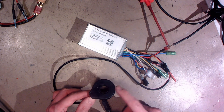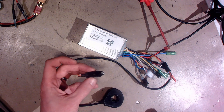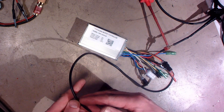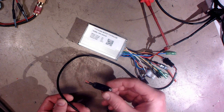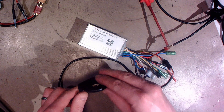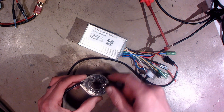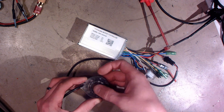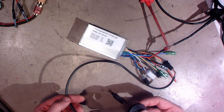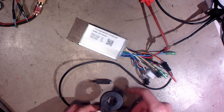But I don't want to install this to the bike because the bike already has this kind of hall sensor. I just need to measure these wires and cut off here and make this sensor work, so I don't need to remove the cranks for this sensor. This looks very suspicious - I think those are the magnets and this plastic wheel, when it's spinning, the sensor is there. So I just need to cut this wire and then measure those wires.